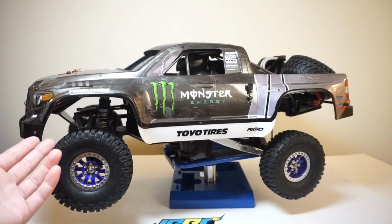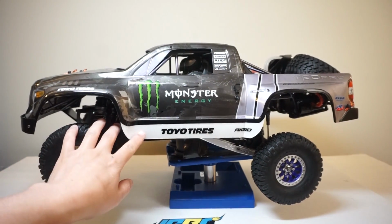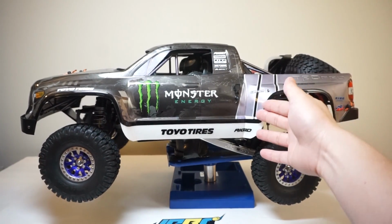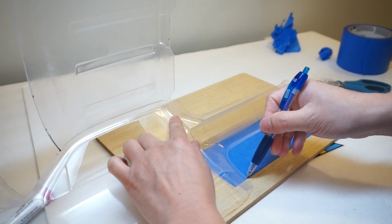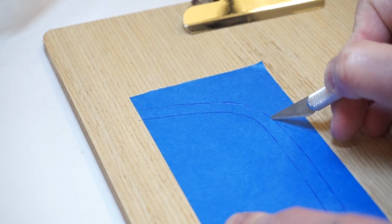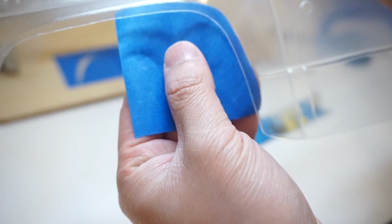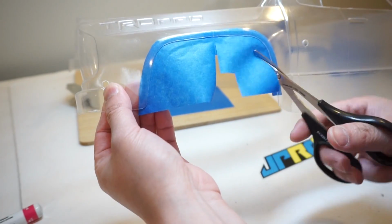The standard black, white, and silver sections here were very easy to mask, and for the line along the fender, into the side, and into the rear fender, I simply traced it on the bench, and then I was able to cut out the masking from each of the masking papers on the bench and then tape it back onto the body. It was an extremely straightforward process.